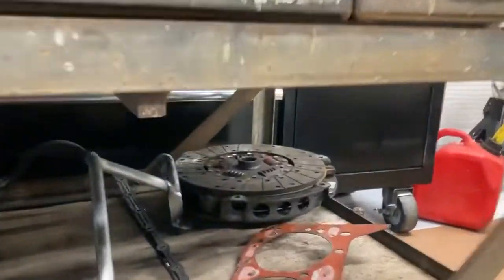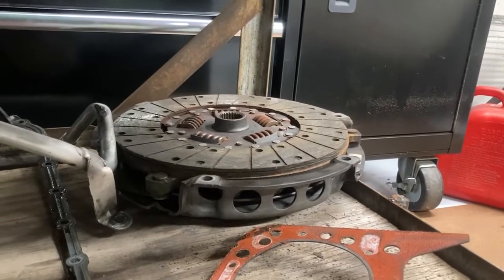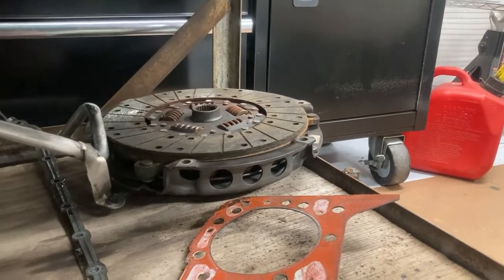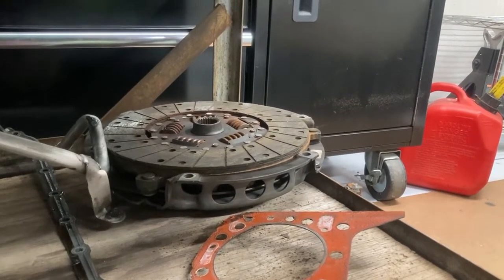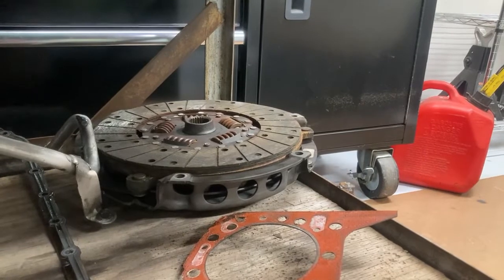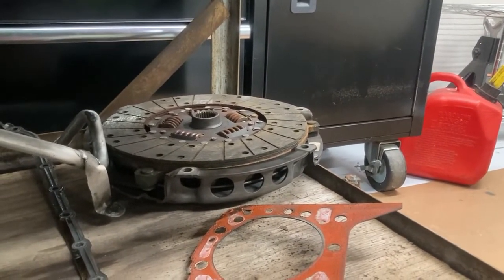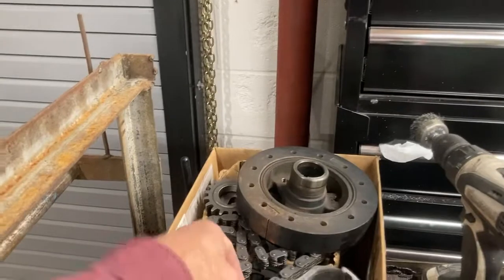The clutch for this thing — I've had several different clutches in it over the years — but for the 4-plus-3 Doug Nash, that's a factory clutch and it's still in pretty good shape. I had a Spec model in there that never worked right. The specs weren't right for this setup and it always just flashed and slipped a lot. This factory clutch doesn't slip — you can make it slip if you really dog it. The flywheel has been balanced with the motor, or the motor has been balanced with the flywheel.